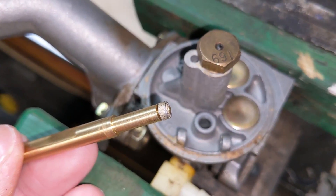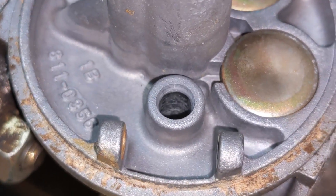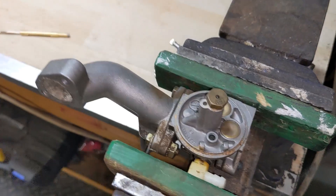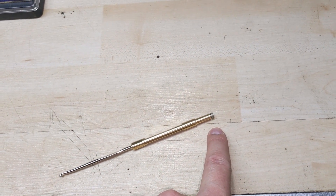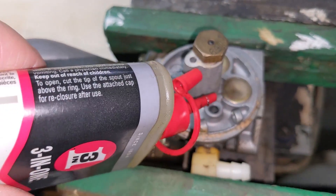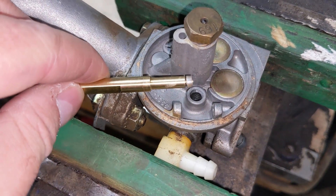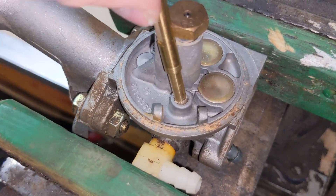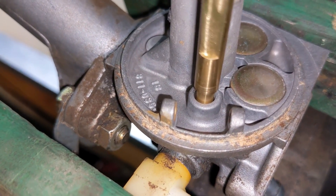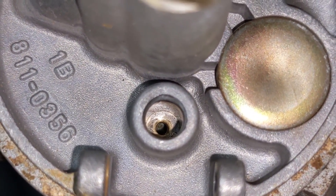Sometimes these little rubber seats can chafe or rip inside the carburetor, because depending on who made your carburetor the inside may not be machined all that smoothly. In order not to rip the brand new rubber seat, I have here a little bit of three-in-one oil — just one drop is all you need. Put that in, then carefully take your seat and install it, push it all the way down, give it a little twist, press it firmly, pull the tool out, and your seat is now installed into the carburetor.